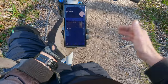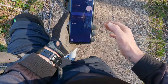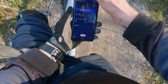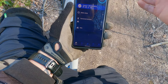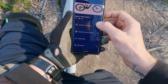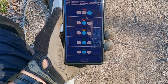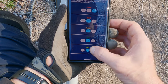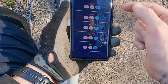Now what I want to show you in particular here is the Ride app — really useful to get into the weeds of this to set up your bike correctly. Once you've got it connected via Bluetooth, the bike is connected. Straight away it shows 86% battery — so if you don't get the exact figure on the dash because it's in 20 increments, you can get the exact reading on there. You can go into the actual setup of the bike — so the modes, SyncDrive motor tuning: you've got eco, tour, active, sport, and power. The only one set to 100% on is effectively power, so it gives you all the torque, but you can change that.